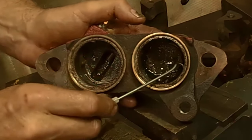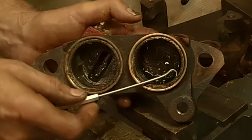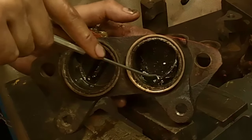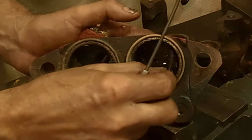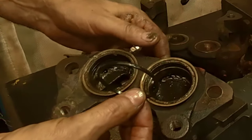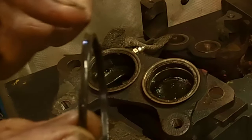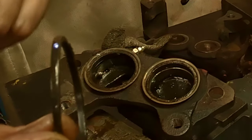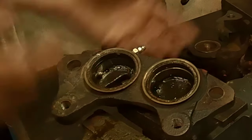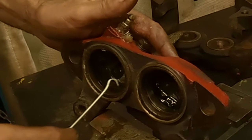Just get underneath. Now, I believe these O-rings are square all the way across, like from new, but since these have been in before, you'll want to try to keep the side in and out right, because I think as they wear, I can't really see it here, but we'll look later, one side gets a little bit rounded and the other side stays flat. So you'll keep it flat with the outside up, or whatever makes work for you. But you will be able to see once you clean that up what I'm talking about.